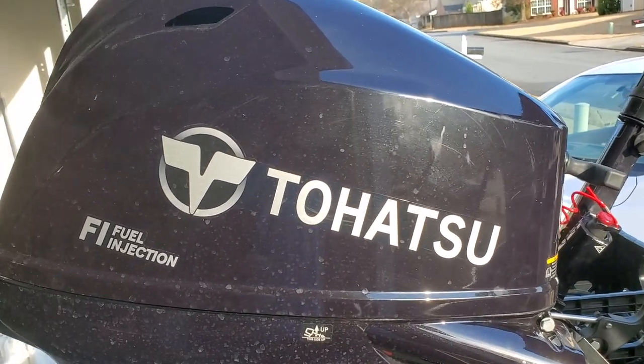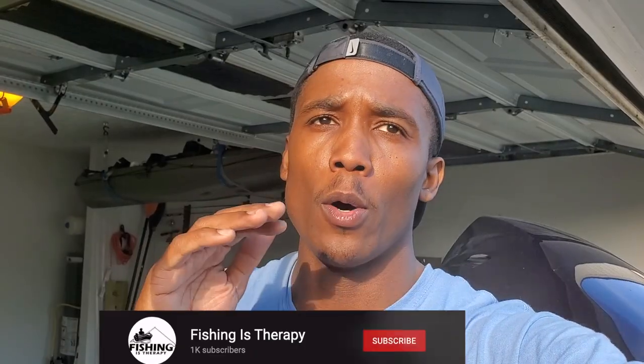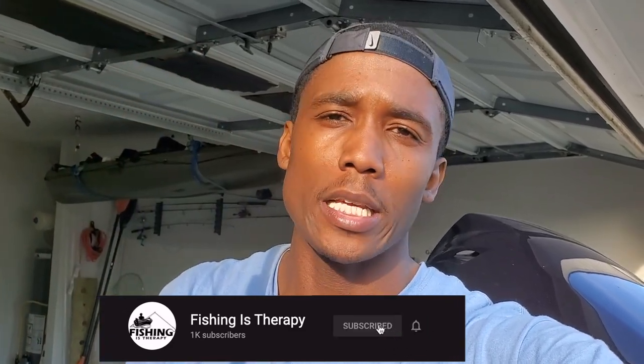I only had one slight issue. When I ran into it, I don't know if it was self-inflicted, but what I think happened was my emergency lanyard — if that's not fully on there, the boat won't start. But I also think it was that I went out when it was super cold, minus temperatures. The boat was sliding down a ramp because people had left water on the ramp that had iced over. The whole ramp was slick and icy. When I got in the boat to start it, the motor wouldn't start. I think the fuel had got a little cold — I had to wait, and when I waited, it started right up. It's electric start so I was like come on. That was my only hiccup. Since then the boat has been great. I think when I took off the emergency lanyard and put it back on, it may have just been slightly loose — so it may not have been the cold at all.